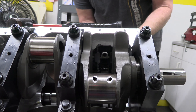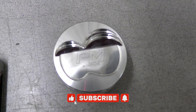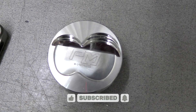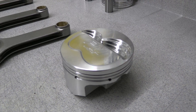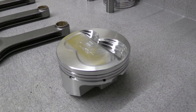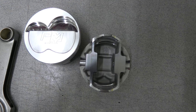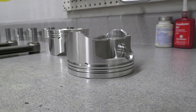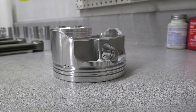We might as well stick some pistons in there. Prestige Motorsports has a strong relationship with DSS Racing Pistons, so they had them make these custom slugs for this build. These pistons come with a 9cc dish to help control the compression ratio and help keep the engine pump-gas friendly. They have a slipper skirt design to minimize both weight and internal friction. The compression height is 1.225 inches.